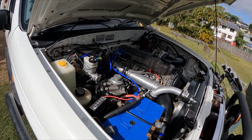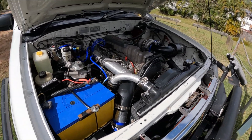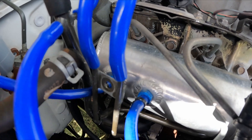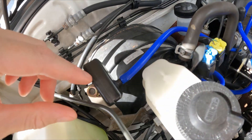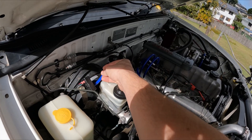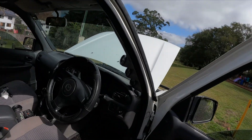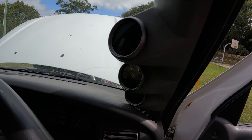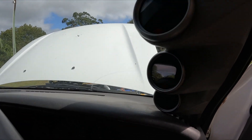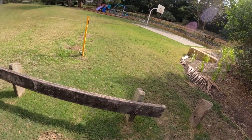Let's talk gauges first — this is for somebody who has never done anything to a diesel and they're looking to get a bit more performance. The first gauge you'd want is a boost gauge. On this one I've got a pipe coming out here that goes into my boost gauge sender. On a lot of older style boost gauges, that pipe will come all the way through the grommet in the firewall to the gauge itself and that's what moves the needle. On this ute it's digital — that little box there tells it how much boost there is. That top gauge there is my boost gauge.